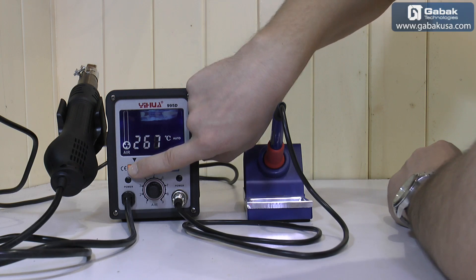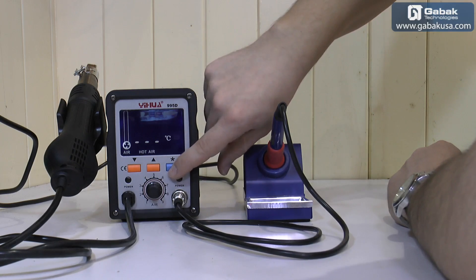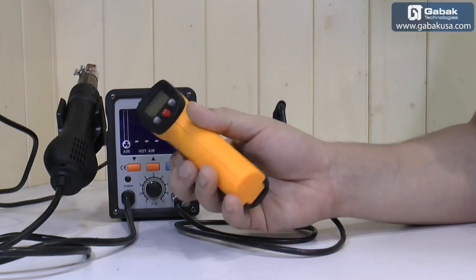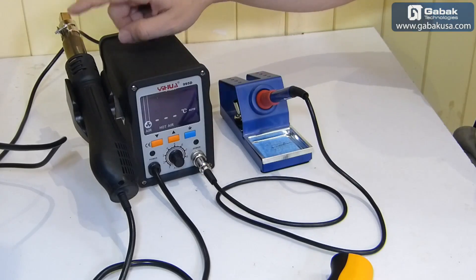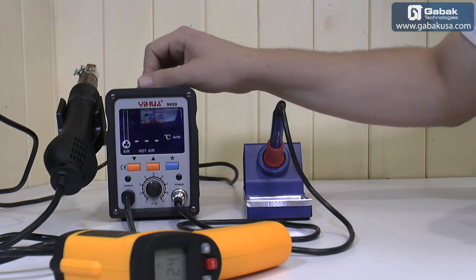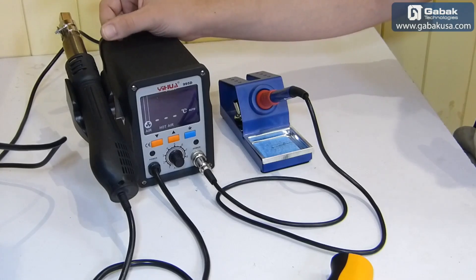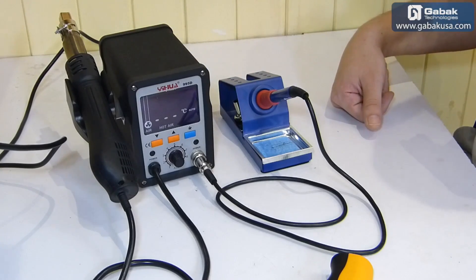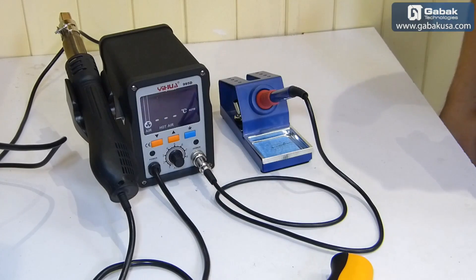It's better to use it at a lower temperature like 150°C for more working time. If you want to measure temperature for cellphone repair you can use an infrared thermometer, but if you want to measure the temperature of the soldering iron or heat gun tips, it will be better to use a thermocouple as it can withstand higher temperatures. I hope you enjoyed this video — click like if you liked it, dislike if not, subscribe to my channel for more videos, and leave any questions in the comments below.